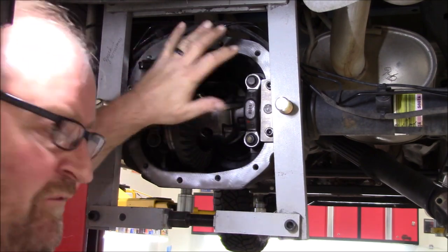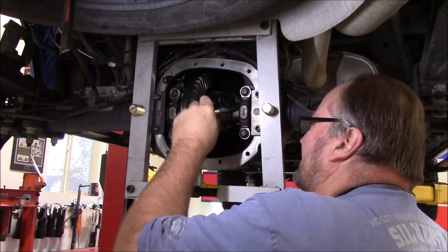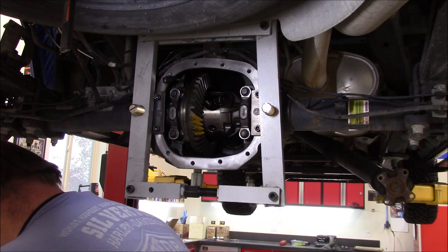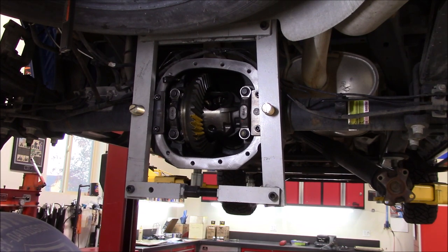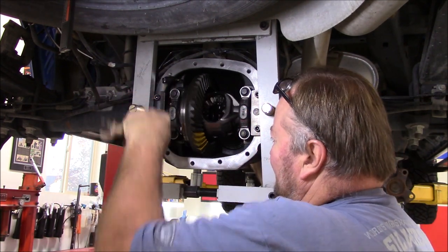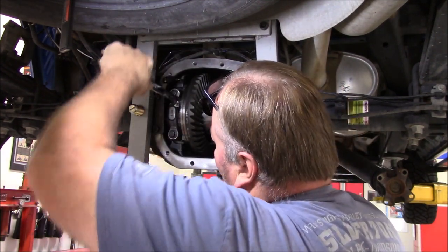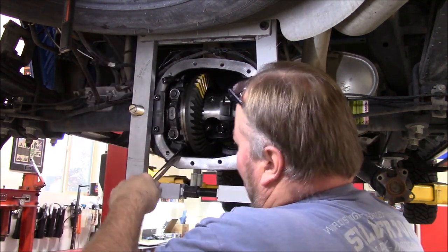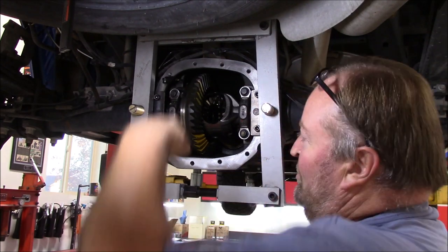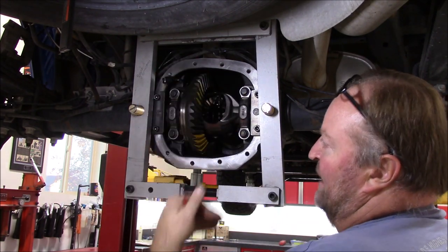Generally I'll put a marking at least two, sometimes three points around the ring gear. But where I'm just trying to get a preliminary reading on pinion depth, I'm going to mark it up one spot, take a rag and create some drag on the pinion, and roll it through a couple of revolutions. You want to go on the coast side and the drive side of the tooth on the ring gear. On your gears, you've got a hypoid gear — it's angle cut — so you're going to have an outside and an inside.